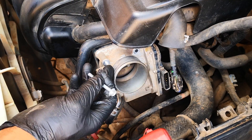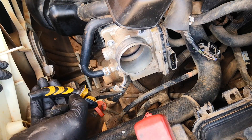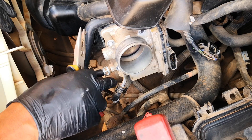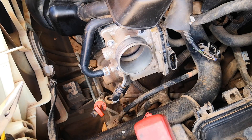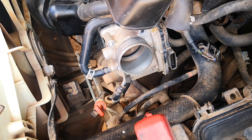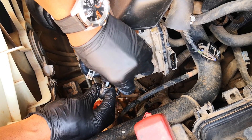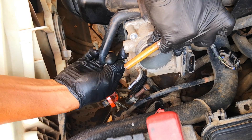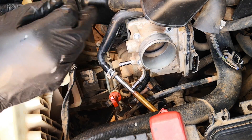One is a bolt, one is a stud. I'm going to take off the cooling lines — you just take out the clips to break the seal. The coolant is already beginning to come out, and that's one of the reasons why I took these bolts out first — I'm going to use them to plug the cooling lines. I couldn't find a similar sized bolt, so I'm using a punch. With that, your throttle body is good to come out.